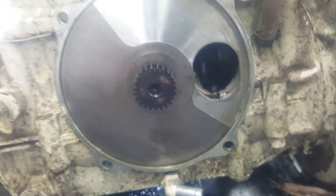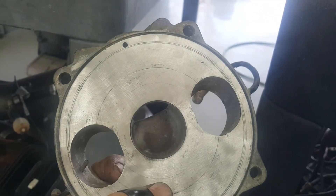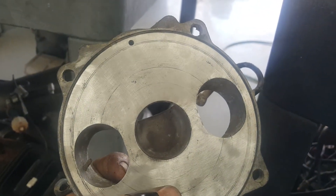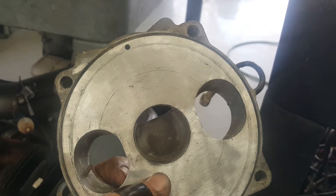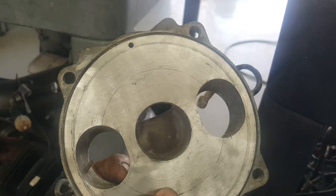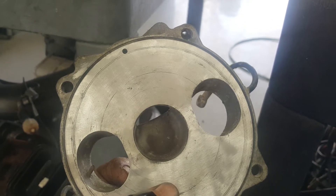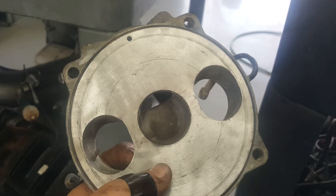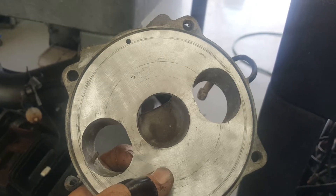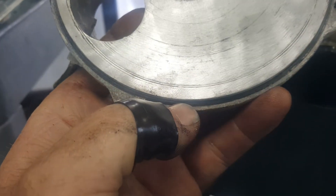Slide that on there, then you have a backing plate that looks like this. Make sure your fingernail cannot catch any deep grooves in it. If you have deep grooves, send it off to SBT or buy a new one. Surface scratches are normal, but a deep groove that catches a fingernail will cause you to have no power in the water — it won't take off — and people start tearing carburetors apart and can't figure out why.